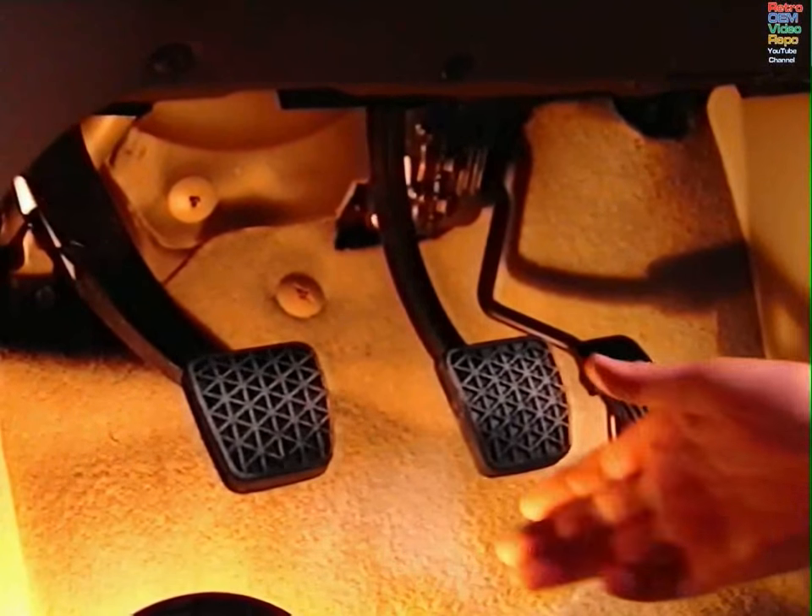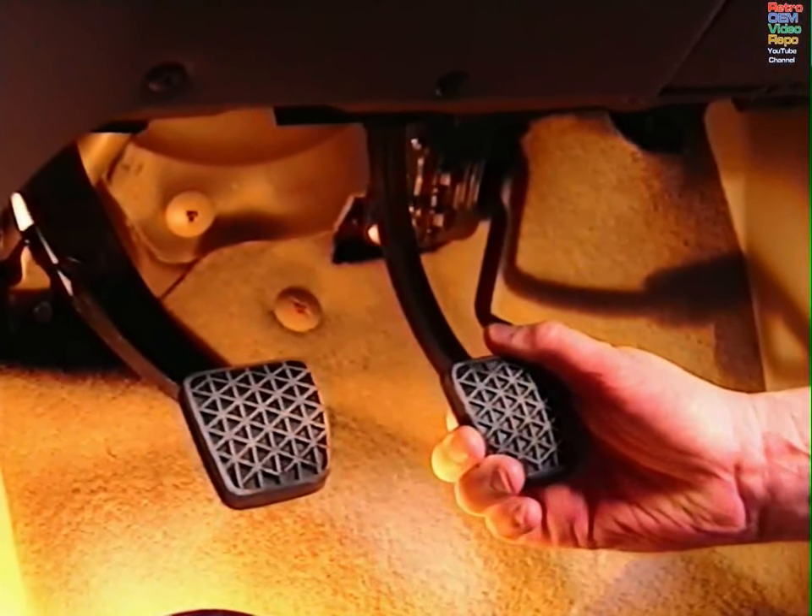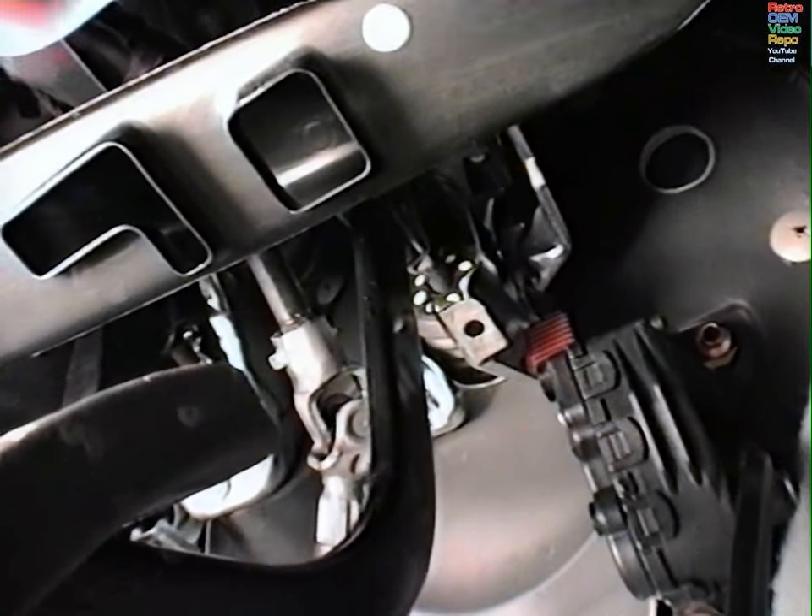Okay, what do we do now? I have to look down in here, Robert, so I'll need to get out of the vehicle for this. I need to be down here to see these components. Some of us more mature testers prefer to carry out this check when it's on the hoist — we can get it up to about waist height, which makes it easier. I'll certainly need a lead light. Very often vehicles can be completely covered in there — the tester can't see anything at all; if you can't see it, you can't test it. On a vehicle where you can see everything, I'll be looking for security of the pedal and its pad and its lever, wear in the spindles and cross spindles, clevis pins, locking devices and retaining devices. It's a prescribed area in and around where the mountings of the pedal assembly fit to the vehicle. I'll also be looking for positive hydraulic leaks.